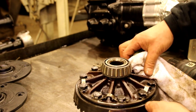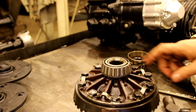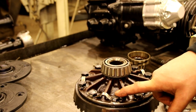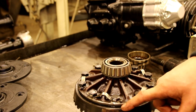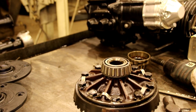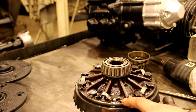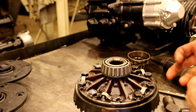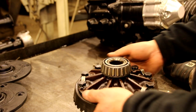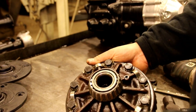When they're in there and everything's fine, it looks good, I leave them in there. If I replace them, get a very high quality bolt for that, and a little bit of Loctite, put your ring gear on like that, and you don't need these. These are just a piece of very soft steel, and with a modern bolt you can just kind of squish that out of there. That's not what you want. But we don't need to touch any of that here. It's all in good shape. Spider gears are in good shape.